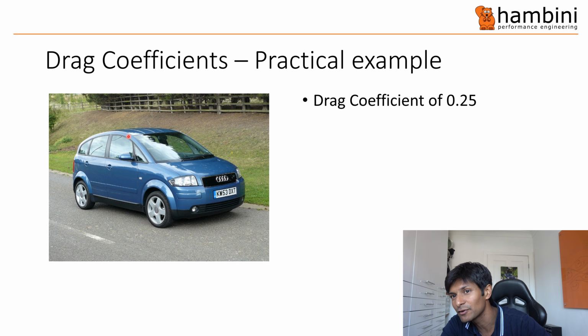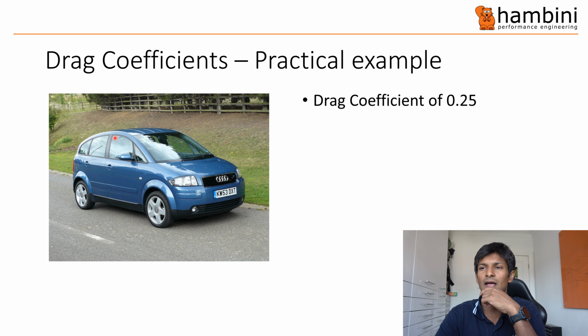Also the roofline has quite a big, curving slope on it, and that aids in reducing the drag coefficient. And then the bumper was a smooth structure. On this side of the car, the ability to reduce drag is not really that important, because you've got high pressure air coming in, or ram pressure increase, so the air will stick whatever. It's when you get towards the back of the car and you're trying to stop the air from detaching suddenly that you get these issues.